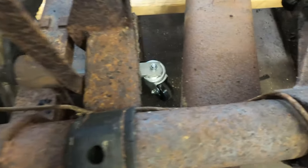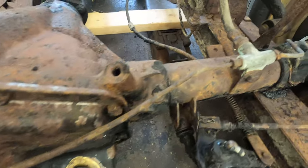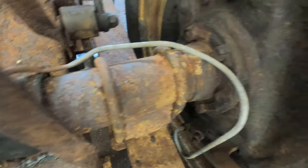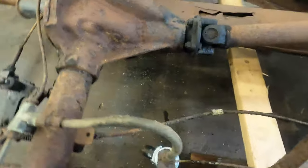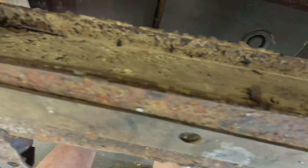And here we're on the port side brake line rear. The rear comes across the leaf spring, up over and around the pumpkin into the T. Note on the rear here, the T has two hard lines out into the brake drums — there are no hoses there. There is a hose coming into the supply for the T, and that goes to a mounting point, transfers back to a hard line. This hard line runs along the starboard side of the car, along the outside frame rail there.